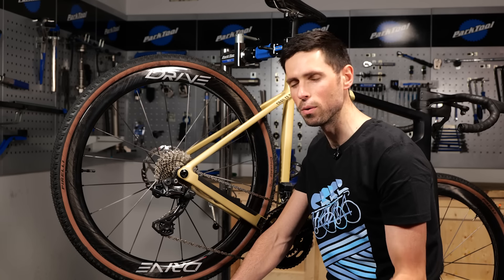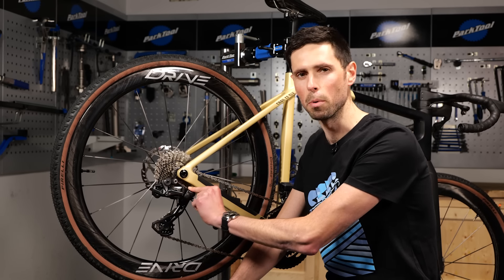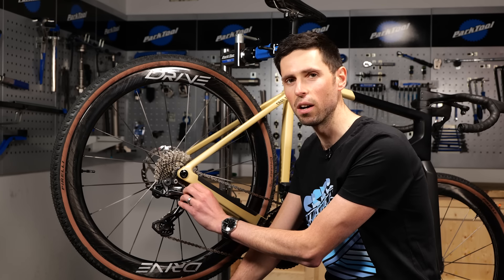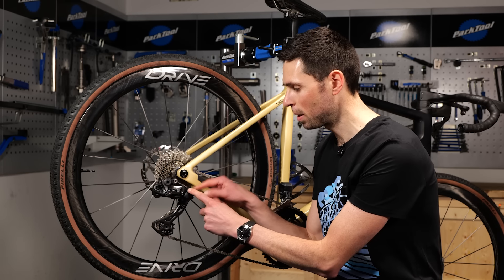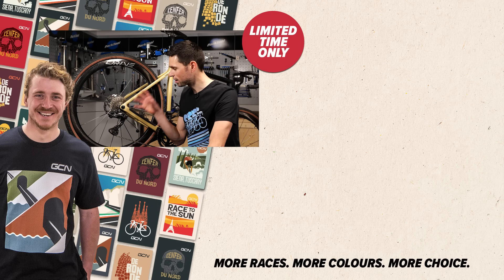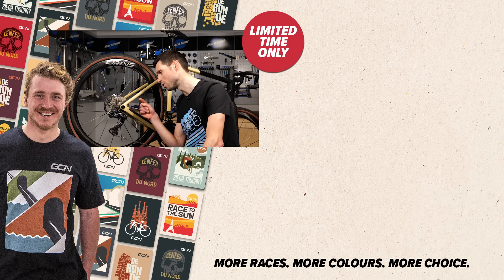It is important to note that the clutch unit inside here is a consumable part. So if your derailleur is particularly old or the bike's had a tough life, parts inside here are going to wear. However, most big brands will sell service kits which allow you to replace the parts inside here which wear out and then extend the life of your derailleur. I hope that's cleared up any questions that you have and sorted out a process to adjust the clutch derailleur on your bike.